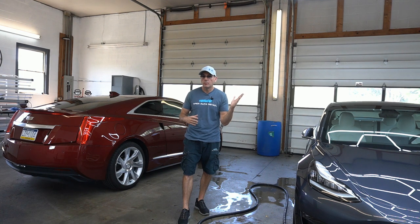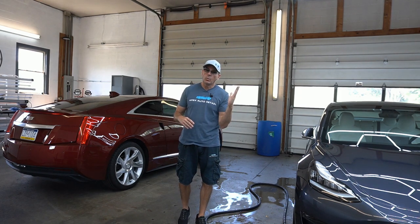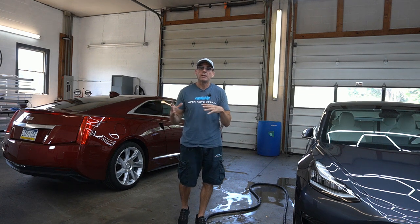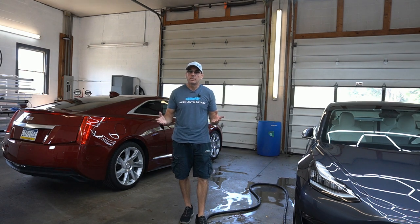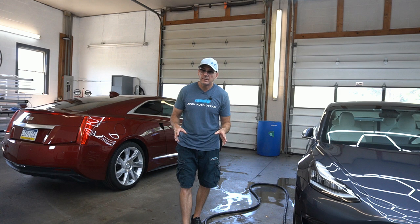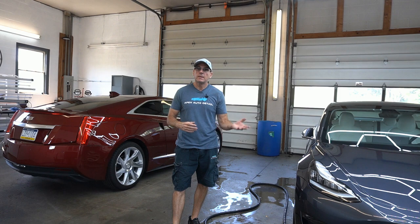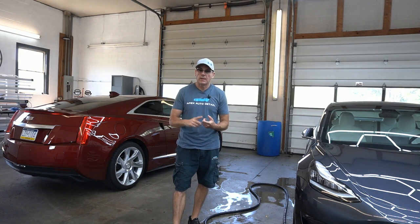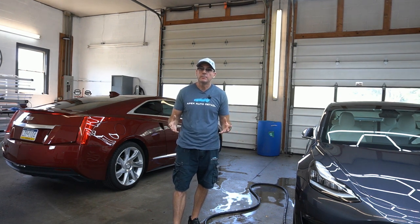It's not complete. We're only talking about a partial transfer of organic to water, and we already have the huge difference in thickness, going from what was a little bit more tenacious of a clear coat in the early 2000s to now very soft, very thin, cannot deal with rock chips, cannot deal with scratches, cannot deal with heavy correction. So we went from back in the day doing multi-step corrections to enhancements and one-steps for the most part, because paint surfaces today cannot handle much more.